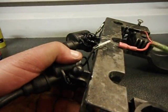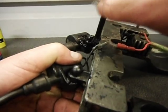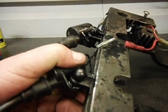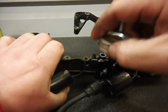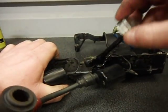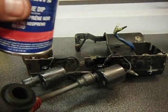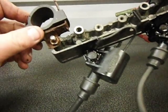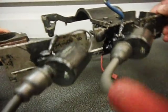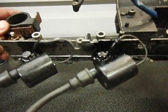This dries kind of matte, so once it's actually dry it does look quite nice on there. As I said, they don't do this in the factory — I don't know why, it would take 20 minutes per engine to do this. It will make the coils last longer, it will give you a better earth, it will give you a bit more reliability. Just let that dry, probably for a couple of hours, and then once it is dry you get this kind of nice sealed earth terminal. That should stop any corrosion or water getting in there and prolong the life of your coils.